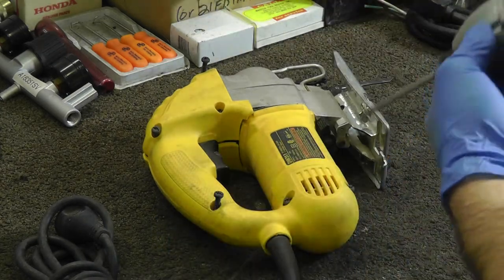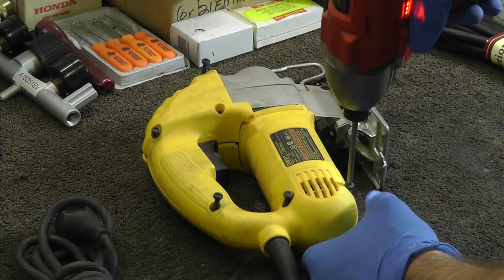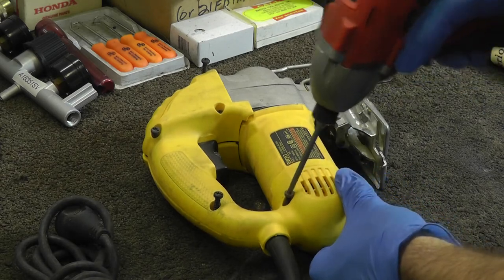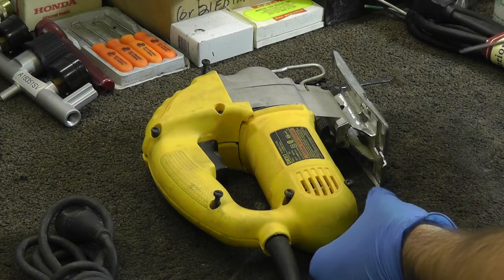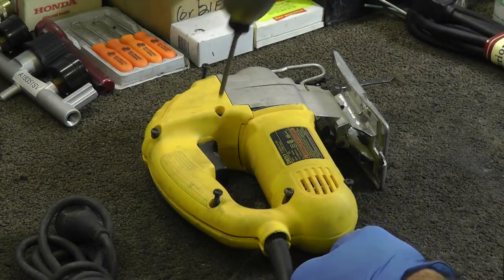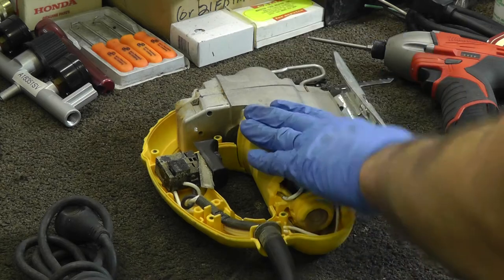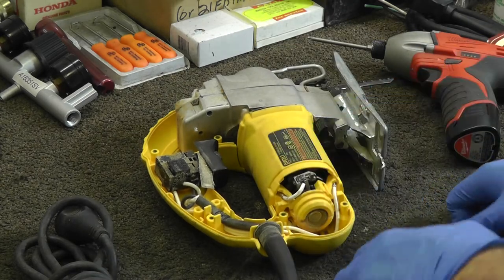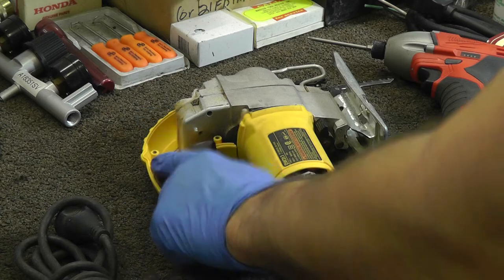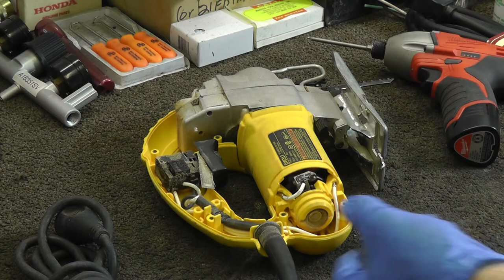You already have most of the star bits that hold the handle half on unscrewed. Most of these are star bits now — this is a T20 size bit. You have T15, T20, T25s. Most of these tools use a T15 or T20 star bit. So remove the handle and all your electricals — there you go. You have your motor, your brushes, and of course your field inside the motor. You have your power cord; it runs up to your switch. Most of your corded power tools will look just like this, and a lot of switches may be wired differently, of course.